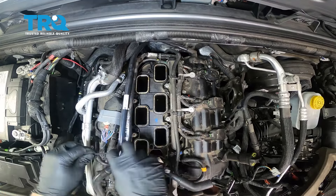We went ahead and cleaned off the ports to the heads and taped them off so we don't have any debris falling down inside. Next, we're going to use our E8 inverted Torx. There are five bolts to remove the oil cooler from the engine. We're going to start this in a pattern: there is one down in front, just to the left of the oil filter — do that one first. Second, the back one. Third, the forward one right here. Fourth, the opposite corner on the rear passenger side. Then the fifth one right here.